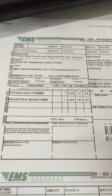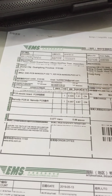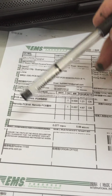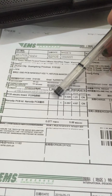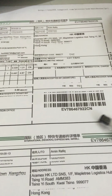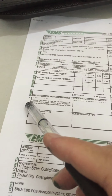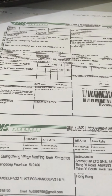As you see, this is the printer, an ink printer. These ink printers have a problem when you print. You can see it has many blank bars. Some images cannot connect together, and it has a very serious blank bar print without any printing in the back.